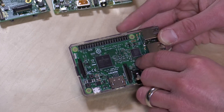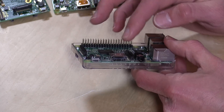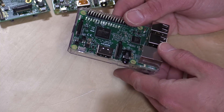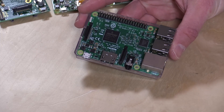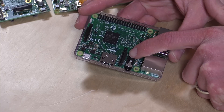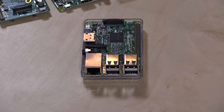Any kind of 2-amp tablet adapter should be fine for the Pi 3. Older iterations of the Raspberry Pi consume less power, so if you need very low power operation you might want to consider one of the other models — they're still selling all of them. You plug the power in over here, you have HDMI out for your display, analog audio and video out, 100 megabit Ethernet, and 4 USB ports for plugging in peripherals. Be careful not to plug in something that draws too much power — if you have a hard drive I would suggest getting a powered USB hub — but USB sticks, mice, and keyboards work just fine.